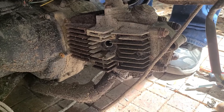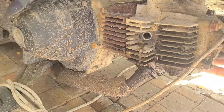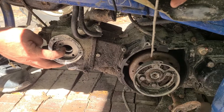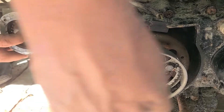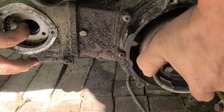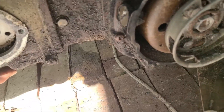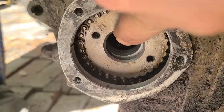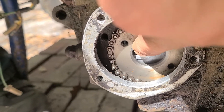See if the piston goes all the way to the top on the F with that dot facing the front of the engine. We're going to start out by making sure the crankshaft is on the F lined up with this groove here. I'll hold the cam sprocket the way so it doesn't bind up inside the motor. Turn it — that's pretty close, it doesn't go up or down. That's right on. Right on? Can you see it? Is it straight ahead or do you think we're off? No, we're off just a little bit — it's almost barely off. Now I'll set this down easy.